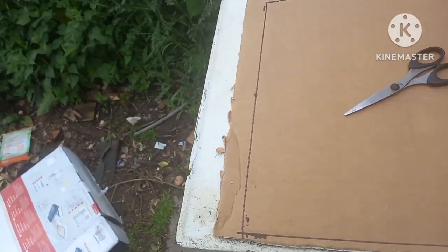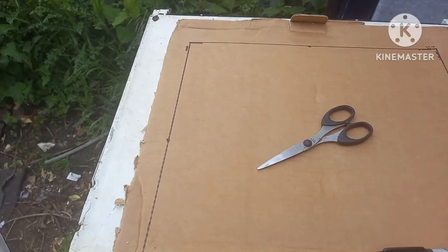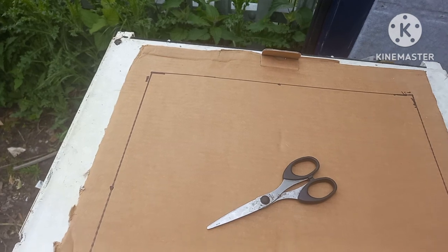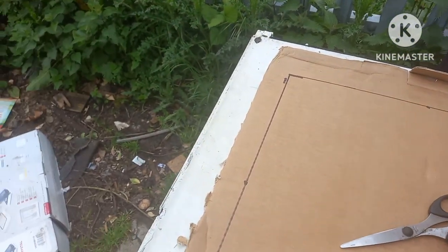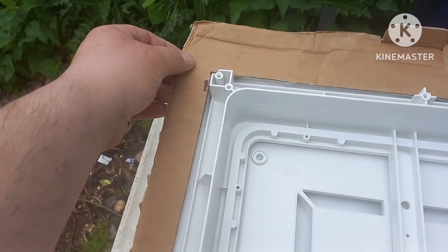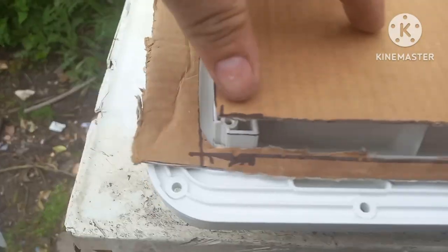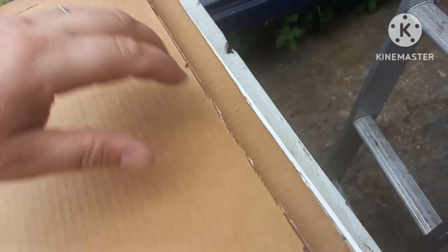I've got my outline there now but I'm going to measure it again just to make sure — it's 390 by 390, which gives you a 10mm gap around the edge to put your mastic strip and your Sikaflex. There we go, there is the template that fits nicely around the outside. We can offer that up, stick it to the ceiling, drill our four holes so we know where we are, because that is a perfect fit over those corner bits as well.